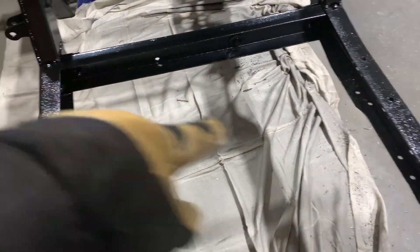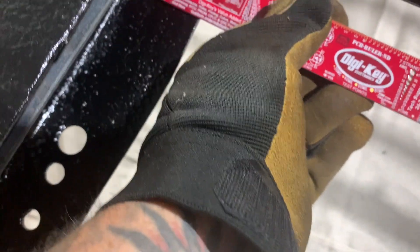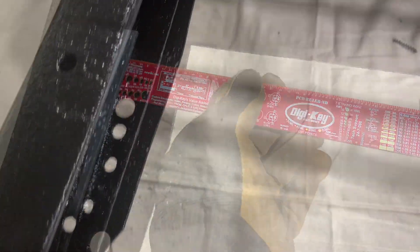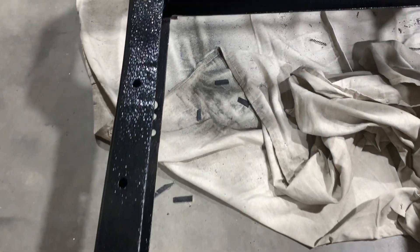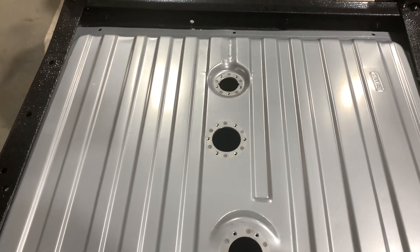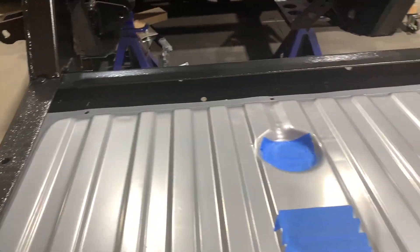With both side rails in, the part I'm least looking forward to is cutting up our newly painted frame one more time. I'm going to clearance these little wings on the bottom and see if the tank fits. The part of the frame that clears the tank is one and five-eighths of an inch, so I'm going up to the wider part, marking one and five-eighths, and drawing a straight line to where it narrows. There we go — nice and evened up. Let's see if the tank fits.